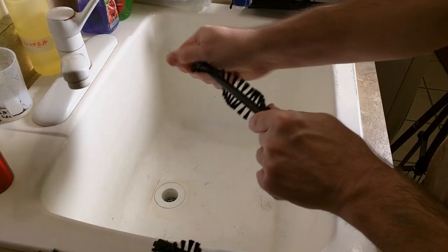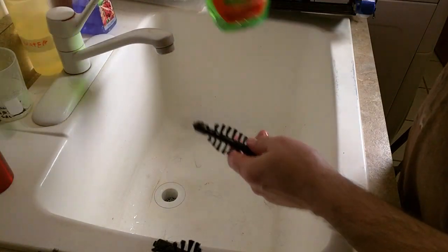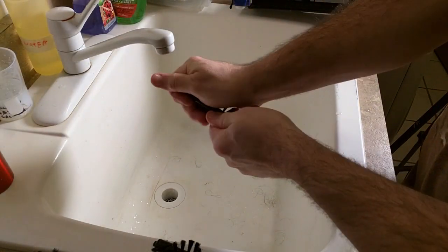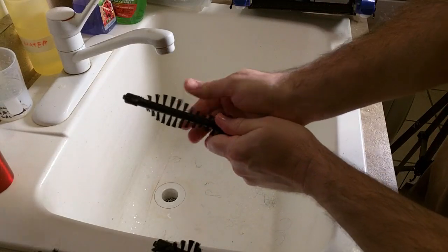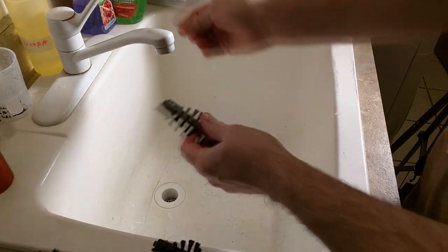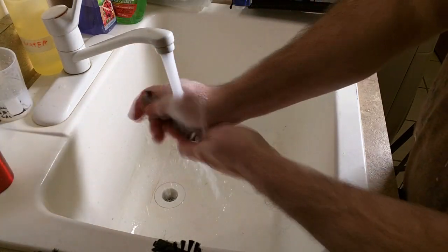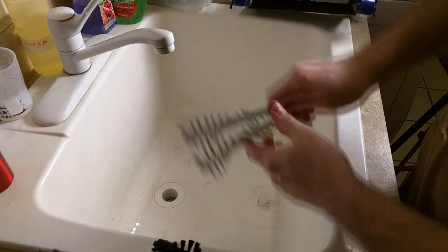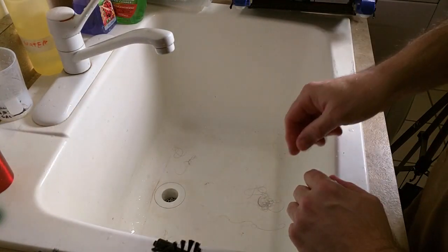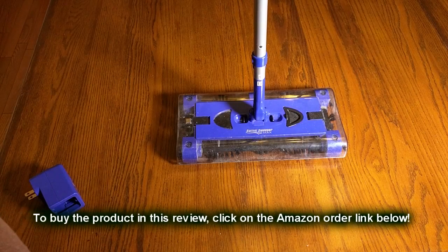I have a utility sink right here with a filter. You can clean the brushes with a little water — I use a little Spic and Span on there and scrub them. Be careful when cleaning the bristles: do not pull on them directly; lightly get the hair off because they will pop out — they're held in by pressure. Once you've put the cleaner on and you're satisfied all the little hairs are off, give it a nice rinse, shake off the extra water, let it air dry. Do that with all the other brushes too, then put them right back in place and you're all set.